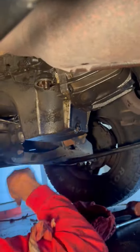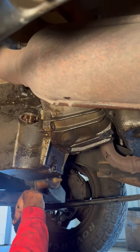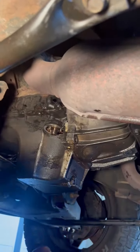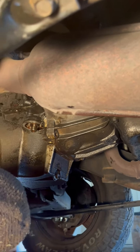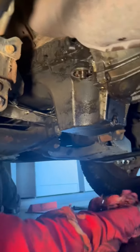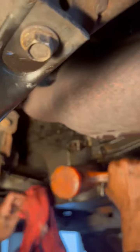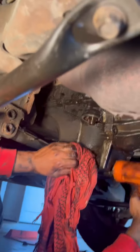Okay, so we are working on an '03 5.3 liter Silverado. We are doing an oil pan gasket. We have done all the bolts on the oil pan — all the bolts that are vertical, that go up. There's about 15 of them. The reason for this quick video is just to show that if you simply remove the cross member, and that's it, you'll have access. We did not drop anything with suspension or drive components, nothing like that.